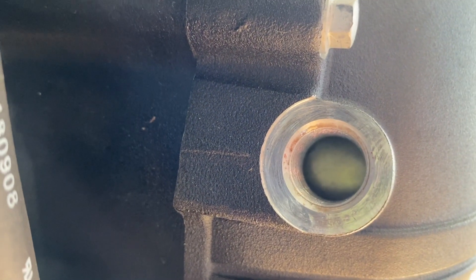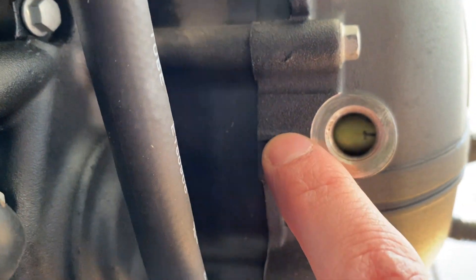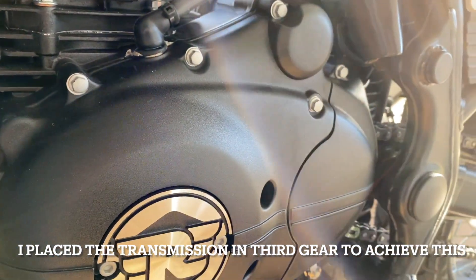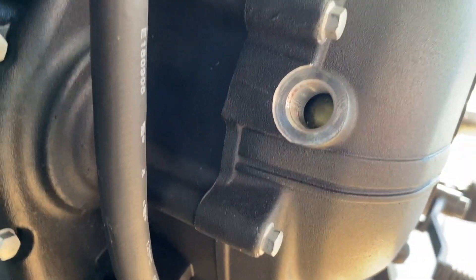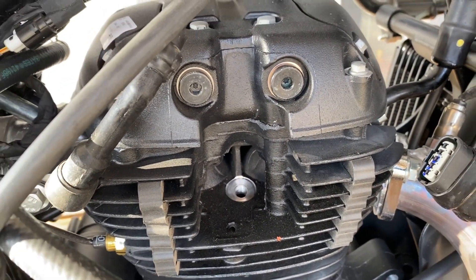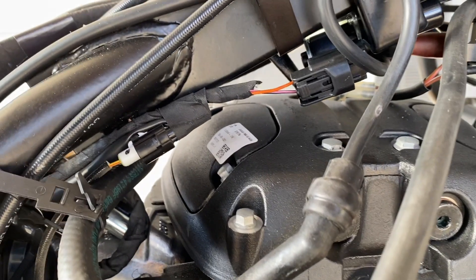There should be a mark in there, and I'll turn it over until I get to that point. As you can see, there's a T, and right here there is an arrow to line that T up with. I did circumvent opening the side plate by using the gearing on the rear end — I just spun the engine over using the rear wheel and my foot to align the T. Go ahead and remove the spark plug that way; you don't have to battle compression during spinning over of the engine, because that's going to give you quite a workout if you don't. Now I'll remove the covers and we'll get to adjusting.